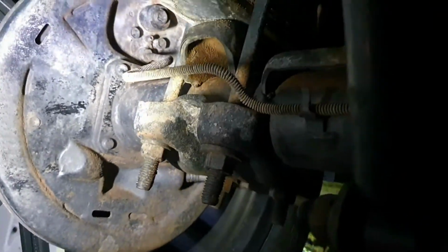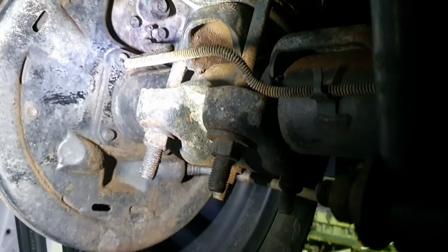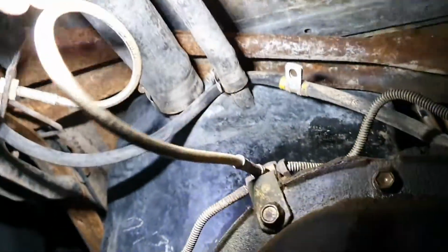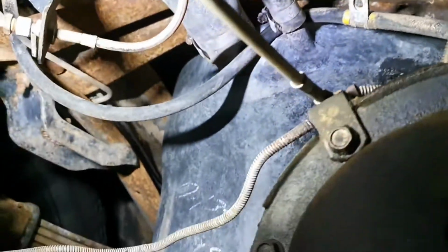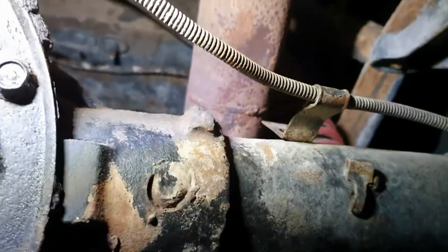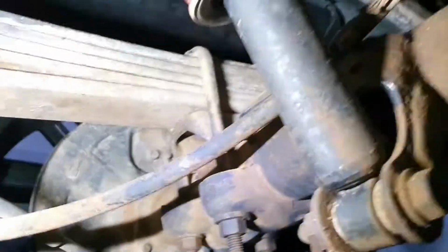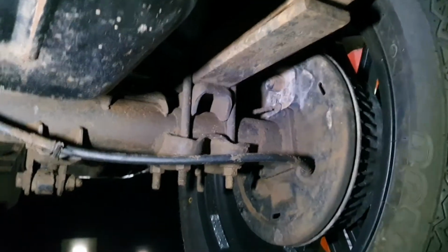I'm planning to jack the back of the truck up with some prop stands under the tow bar, release those bolts and put these bits in. I think everything's long enough to go. Like, and brake line's definitely not the original, it's definitely got tons of length in it. Just gonna worry about, it's a diff breather by the look of it. So, where is he there? Yeah, he's cool. We're gonna move away from that, that's fine, that's good. Handbrake cable, I think there's plenty of length there. They're both fine. No, I think we're pretty good to go upwards.